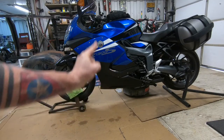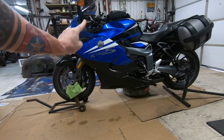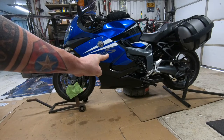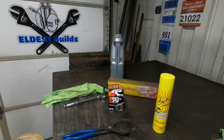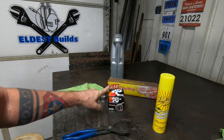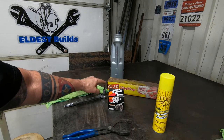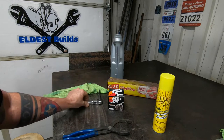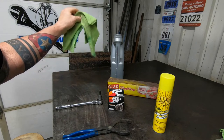On this episode we're changing the oil and filter on a 2011 BMW K1300S — greatest motorcycle of all time. You're going to need a drain pan, oil filter, maybe an oil filter wrench, an 8mm Allen for the drain plug, oil of course, and drip rags.